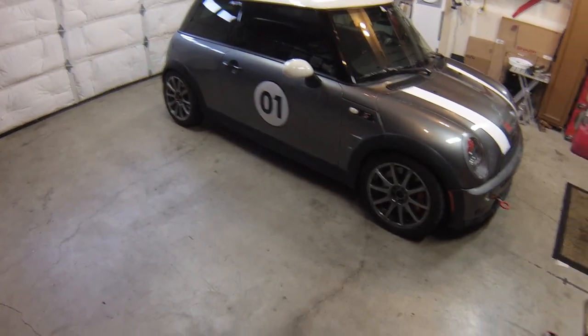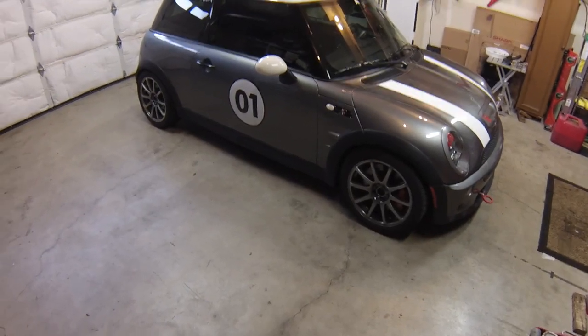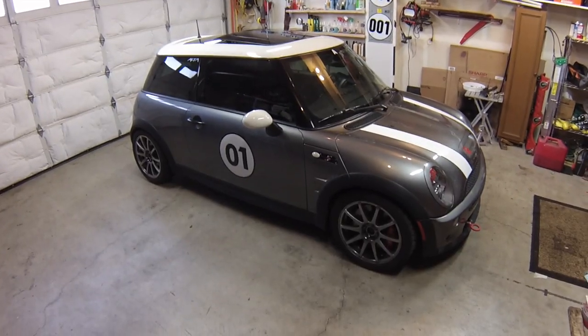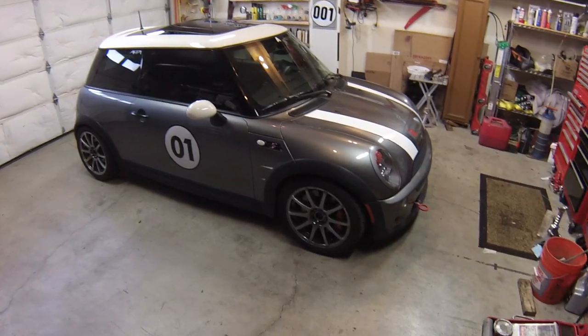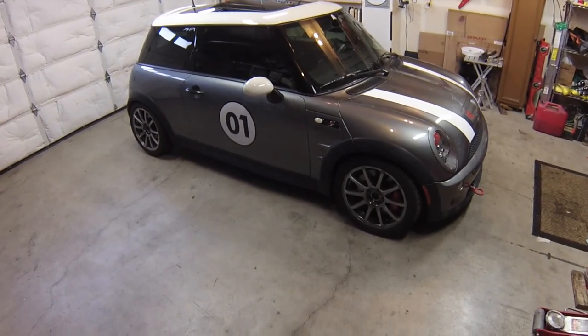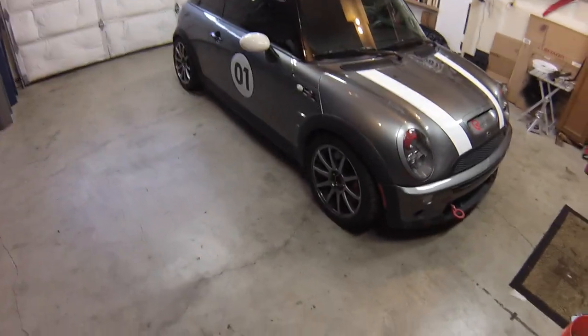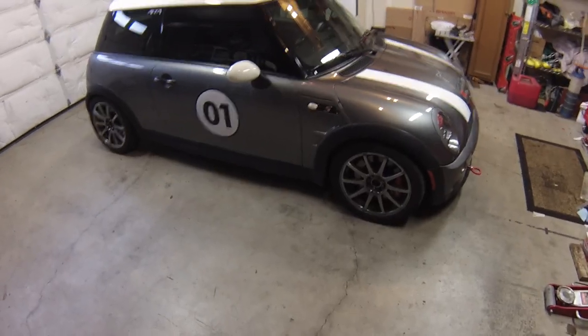Normally people seem to be jacking up on the front plastic jack point using the jack. But what I do is I have a way to put the jack stands on the two jack points, which enables getting the subframe out. I do this using a block of wood, and I jack up under the car just a few inches back from the front jack point. Using this method I can get the car up on all four jack stands in about two or three minutes.